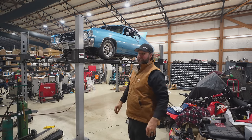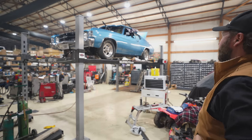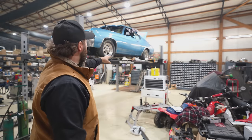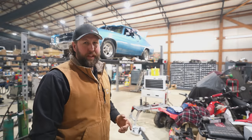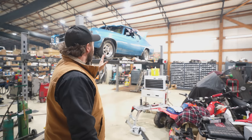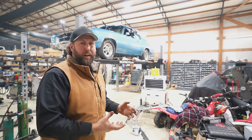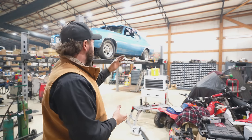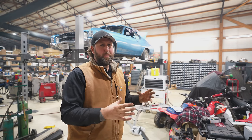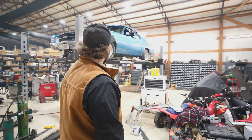Oh yeah. Yep. The front and the rear is gonna sink a little bit. Looks a tiny bit goofy because we have a smaller 275/50/15 in the rear, instead of a taller. We could go a little taller, a little wider, but we're running a small tire, and we want a smaller circumference, which is going to help with our 3.25 gear. That's the same tire and wheel we did on Independence. So because the gear wasn't correct, you can compensate with a smaller tire. So we're going to do the same here, keep the same setup.